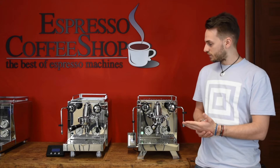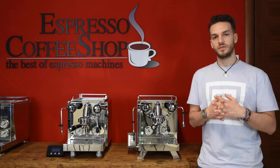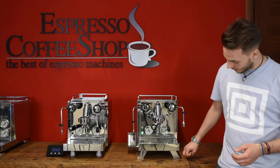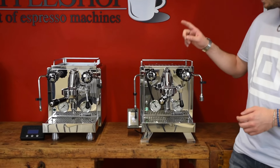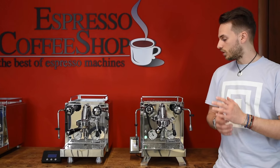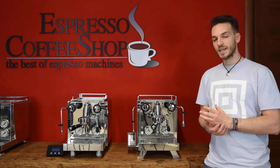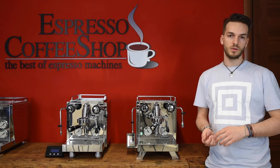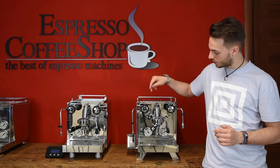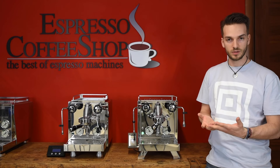As you can see it's very similar to the old one, but if you look closer there are some new features that you will notice. First and foremost, the new feet, which are a great piece of design compared to the old ones. We have a new PID which is now completely digital. Inside, it's the same copper dual boilers — one 1.8 liter and the other 0.58 — and it has the new chronometer, which has been used in the Giotto and Mozzafiato machines.